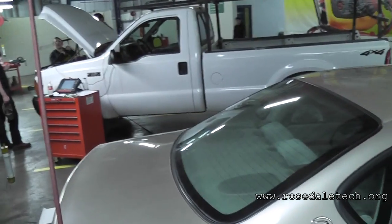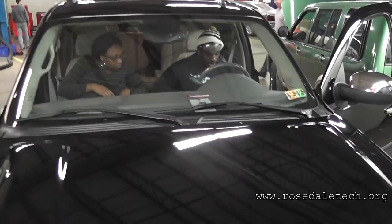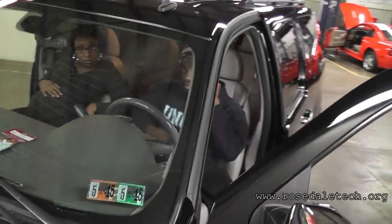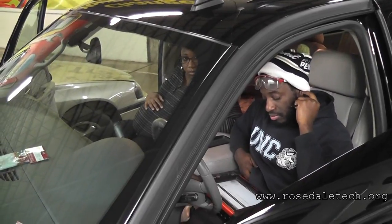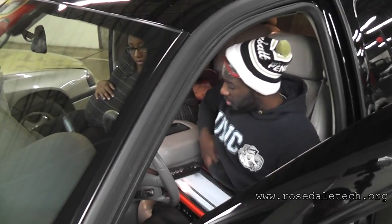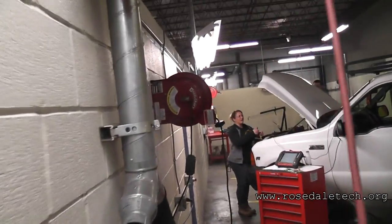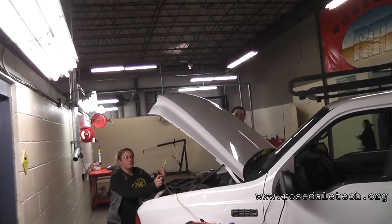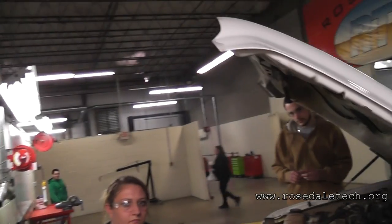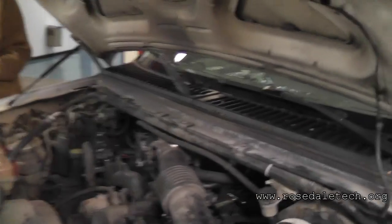Scott, you got a battery charger on that? Good. And we still are missing a power feed — double-check that for me. The cranking test again: we should have one hot all the time and one should be hot when we're cranking. We have a fault code — left front actuator short to battery. Write that down. Grab a repair order. Write this down for JR because he's going to want to know this.